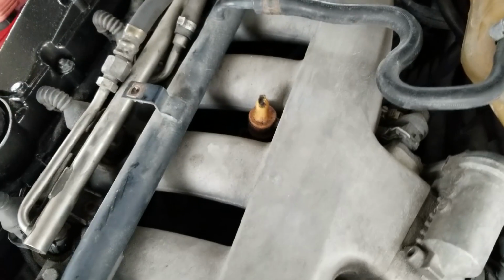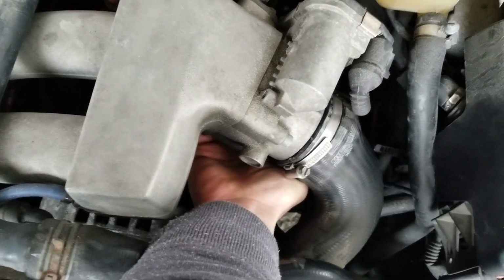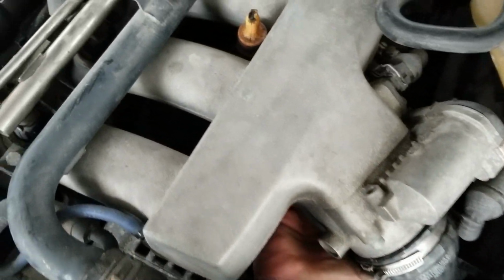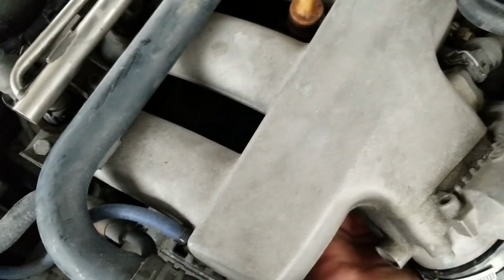It's not a misfire, it's a vacuum leak. I'm so stoked. That is just great news. Hey, good news, guys. It works, like it actually works. And the engine sounds good, as long as my finger's plugging this hole down here under the intake. So I'm going to have to get a plug or something to plug it up, but ow.